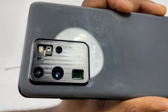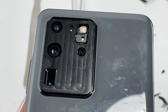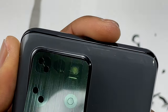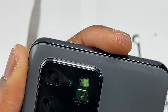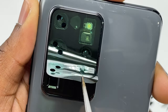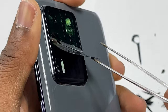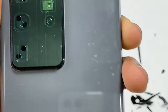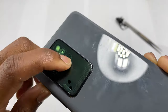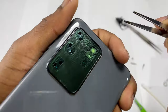The camera bump is completely cleaned and we have removed the tape as much as possible, so there is no more tape on the camera bump. It's time to install the new tape for the camera glass replacement. Align the tape perfectly with the square and push it down. After that, apply some light pressure for the tape to stick firmly to the back cover, then use your tool to remove the protective film on the back of the tape.